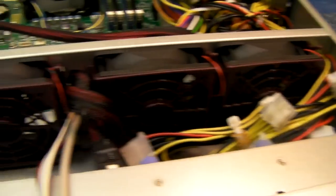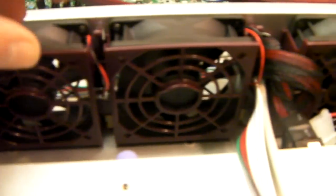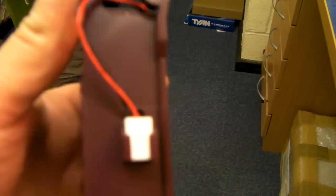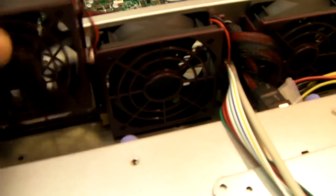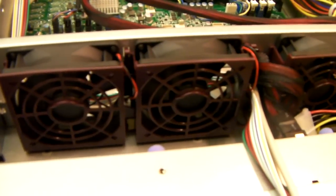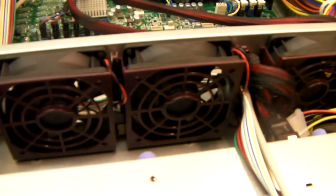The fan setup on the RM208 has improved a great deal since last time. There are four 80mm fans, all removable. They sit in these little plastic caddies, and the fan wire goes into the plastic caddy as well. So if one fails, it's a simple case of clicking it out and clicking it back in again. It's also very easy to change the fans for other makes or types.